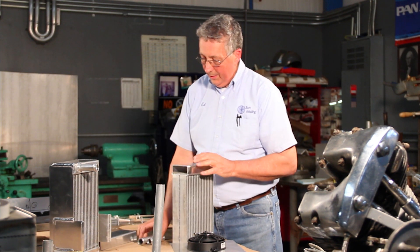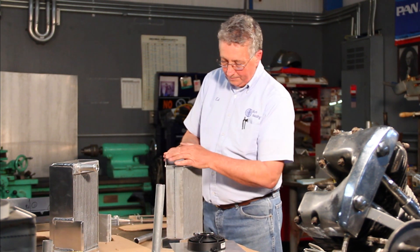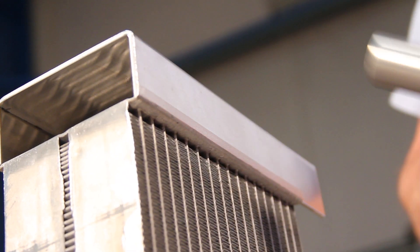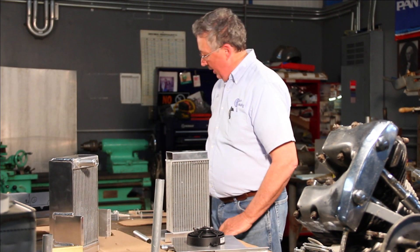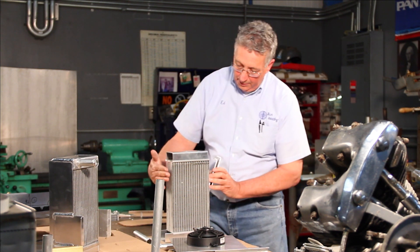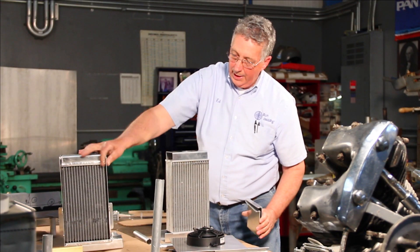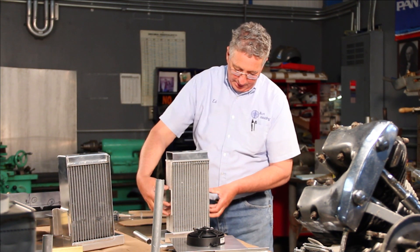Then you have your other tank which, as you can see on the other sample, is stepped out. That will be put on like that, and these are a little longer than those ones but they'll get machined out and welded in there, and that will be cut out and welded in there like so. On the side we have the mounts. There will be another plate of aluminum — a finish-off plate — that will go on the side here, just like you see this piece over here. It serves two purposes: it finishes off the side of the rad, and it's also a mount flange for your ducting, and off that your mounts will be welded.